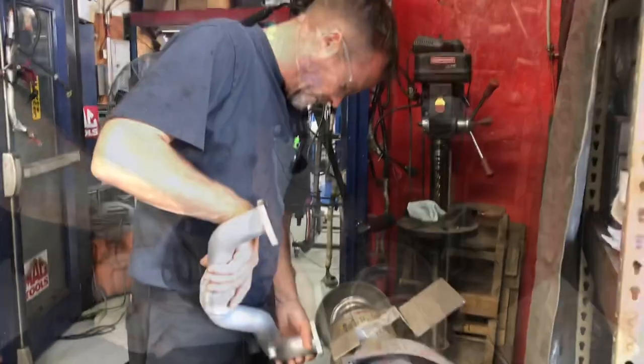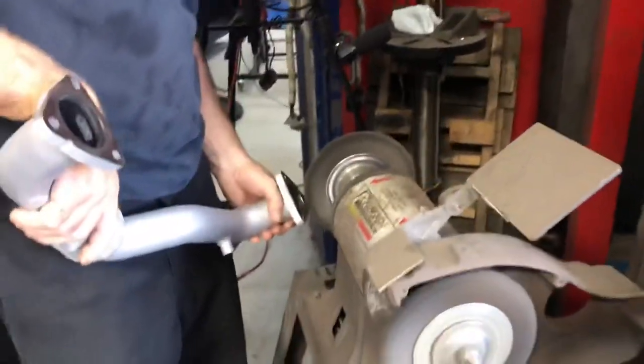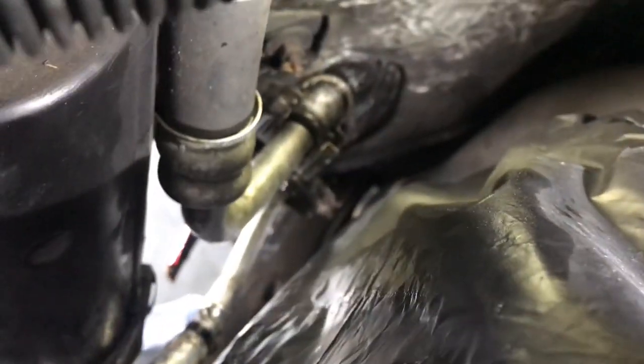That's the bench grinder — about dead. We'll just touch off a little bit. Let's try to clean some of that off, just try to make it nice. All right, right down there we're getting the accumulator out. So I covered this with a trash bag and we're gonna brake clean it down there — I don't want to get it in a lot of places. Brake clean and blow gun, clean the whole connection up before we go taking it apart. That grease right there — you gotta use brake clean on that grease. It's the only thing getting it off. It's eliminating it. I don't do it on painted stuff, but that grease — it's like an eraser, it's going away. And it just had an exhaust leak and it's sooted. You can see it's pretty freaking nasty out there.